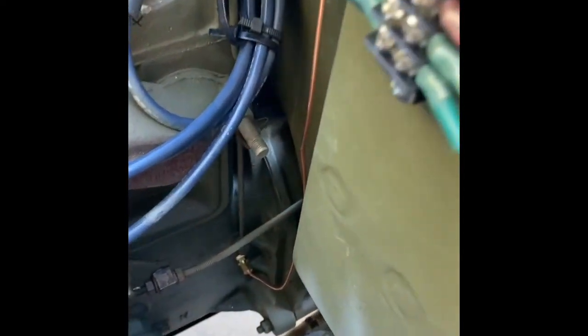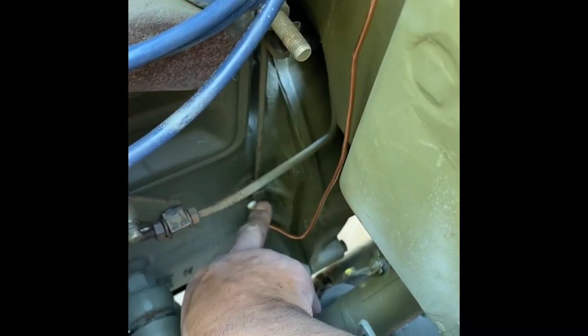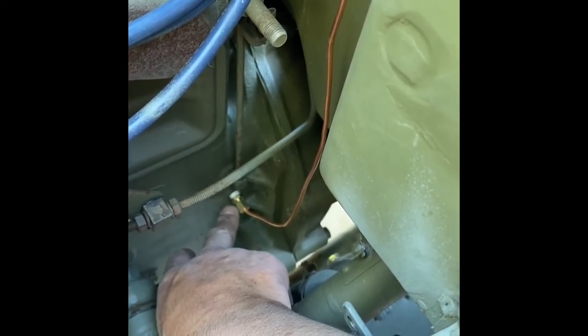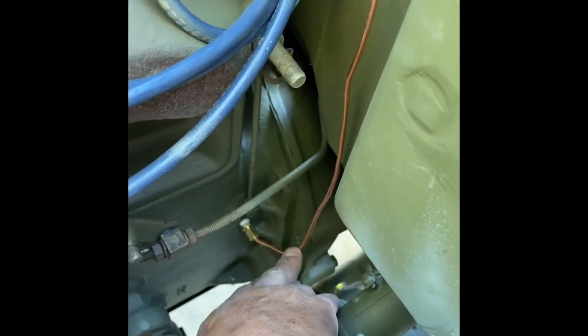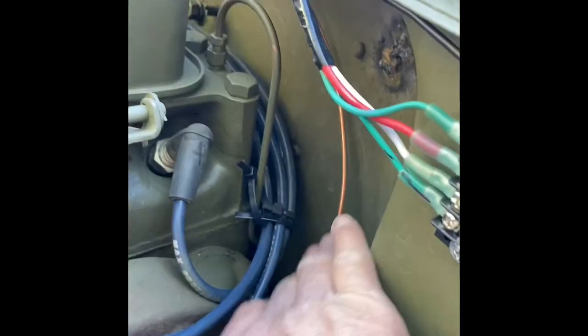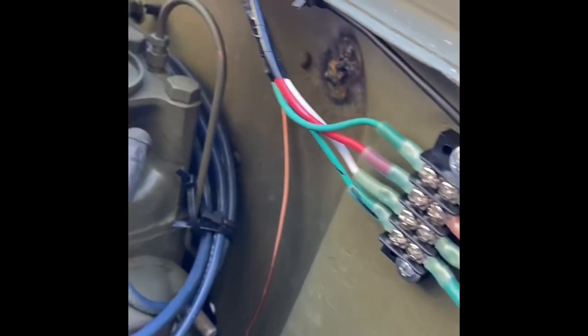This is my F-head. But these fittings that you get from the hardware or auto parts store will fit into here. It'll fit into the block, it'll fit into the 225. I have it on my other Jeeps — 225s, 231s. It fits. And it's a universal kit with the copper line that I like. The plastic ones I don't like because they kink real easy — you have to make a bend or go through the firewall and it's not good. They always break somehow.